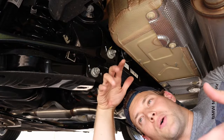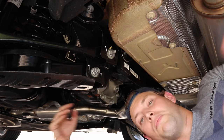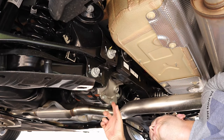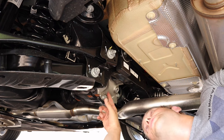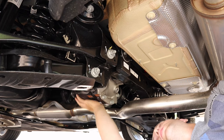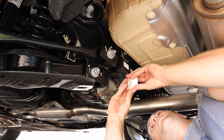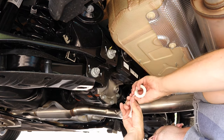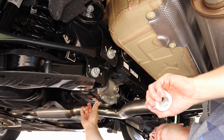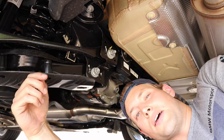When you look under the rear of the vehicle, there's no obvious point like there is in the front — there's no actual designated spot. So what most people do is just use the differential. It's very important when you have your jack to have it positioned more towards the front. You never want to put any weight on the drain plug side because that'll just be a complete mess. Just go ahead and put it right under there and you'll be able to jack the car up and get those jack stands in. You don't really need tape as much in the back — it's just a little easier to see in the front.